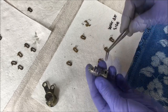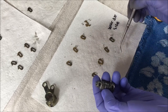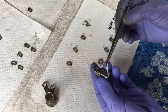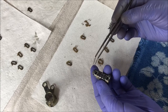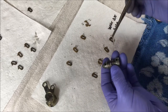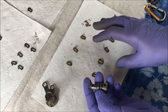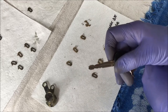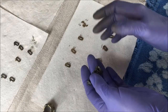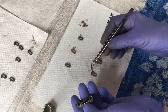All of my pins are out. As you see, I have two split wafers — it's a Toyota thing. A lock cylinder will have a different configuration of pins — I have eight. Some cars have six, some seven; it just depends. Per the manufacturer, the number of pins to key a lock are different. I wrote on a paper towel which pins go on which side, so I know the correct pins for this particular key. I'll show you how to figure out which pins are correct — it's a matter of finding out which pin, number one through four, fits in which slot. The first thing you do is put the spring in.